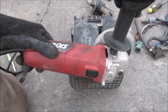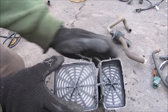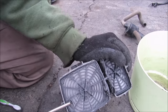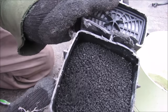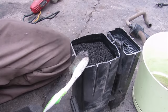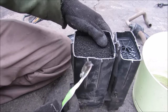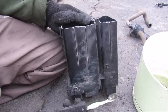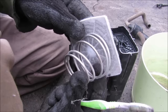Now I'm going to chop this open to see what's inside. There's another spring inside of there, and we have two compartments — this smaller one goes to the vent line and the other two go from the purge line and the gas tank line. Prying this open reveals this filter-like material, and inside we have the charcoal. The charcoal itself is activated and helps absorb any harmful gasoline vapors that pass through this charcoal canister. The lid here actually has a very tiny pass-through, so essentially the gasoline vapors have to come in through here, go out through the top, and then come back around like a circuit, in order to fully process all of the gasoline vapors before exiting out the vent valve to the atmosphere. The charcoal is also kept compacted for maximum efficiency and surface area exposure through these springs and this filter.